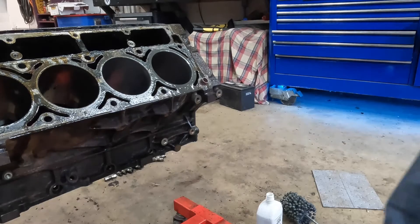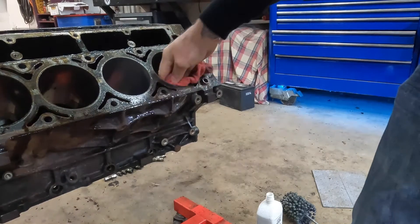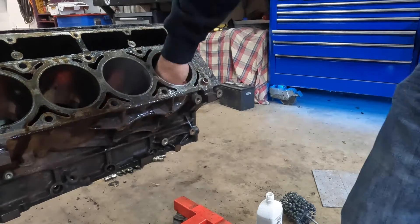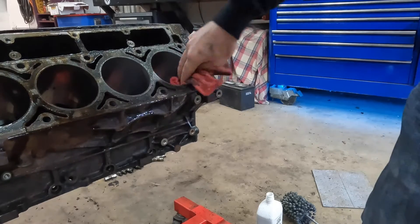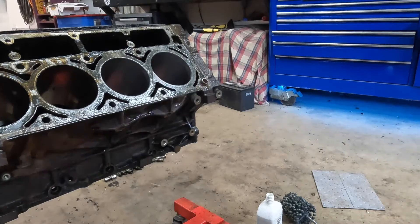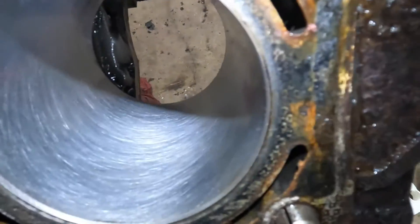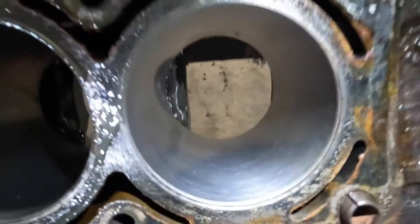So it's out. You can kind of see all that crud and machining oil coming out of it. Let me wipe this out, get my flashlight, and you can see the results and how fast that is. You can do this whole engine in under five minutes. That is the crosshatch and that's a nice deglazed cylinder, literally ready to go. That came out nice and it was that easy.